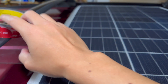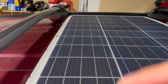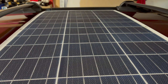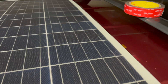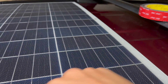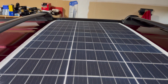The tape is not that thick, and you're smushing it down so it's compacting even more. Over time it will just compact and shrink further so it's pretty much touching the roof — and that's really what you don't want, because the solar panel is going to get really hot. Airflow is not going to be able to get under there to keep it cool, and water is not going to be able to drain out. But I'm banking on these three grooves and the fact that since it's not one solid strip, but spaced, there should be areas of the solar panel not touching by just a fraction of a millimeter. I hope it stands up over time — we'll see.